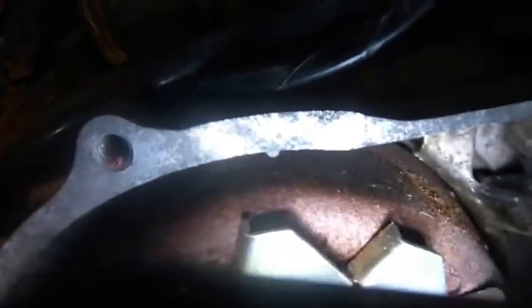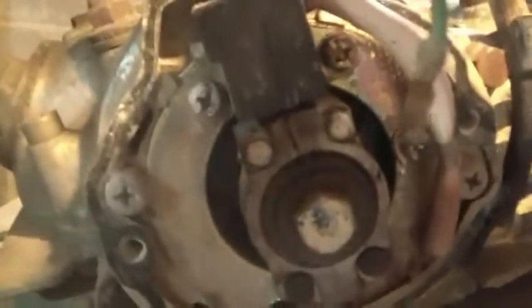There's your little divot right there, and you want to set it up so that the F is right on it. You've got the F and then the line slightly to the left of the F — that line should be lined up exactly with the divot. When that happens, you're right there, and your timing is all set up. And this is the parental guidance part.